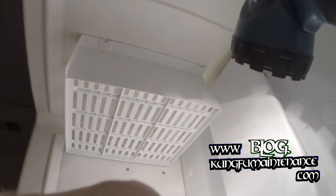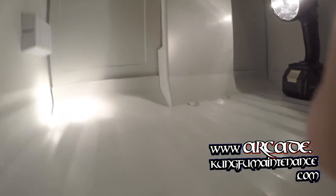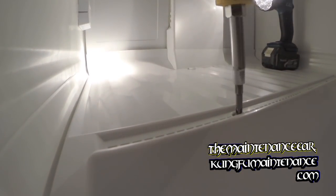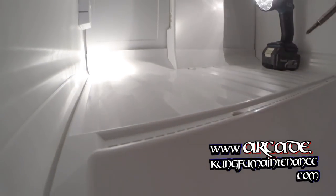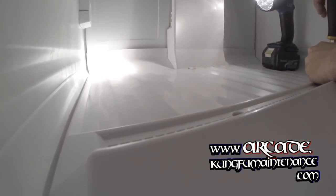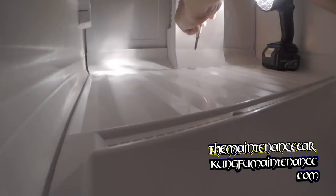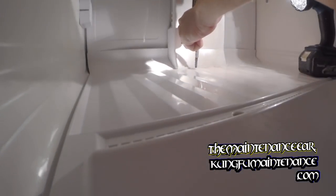What we've got up here is our ice cube tray. I'm going to pull this out of here. Now we want to remove the screws that hold the bottom tray in — it's got four screws, and the longer screws are in the front. As long as you remember that, it'll be alright. Two screws are on the bottom tray, and then back here we've got two holding the freezer channel in place.